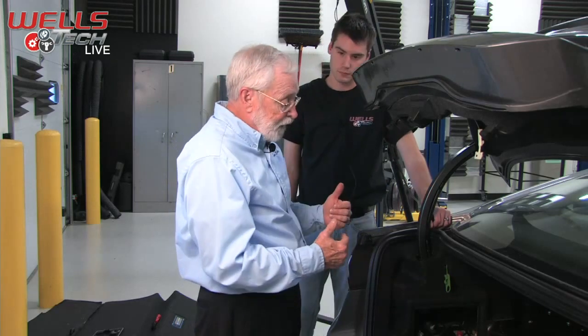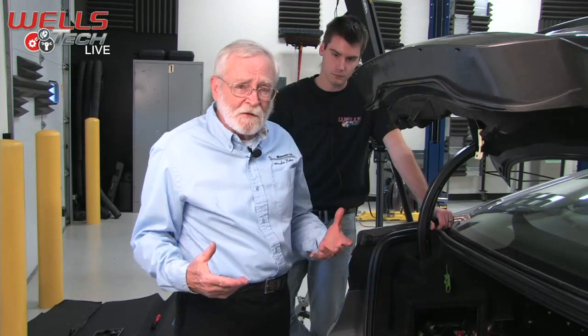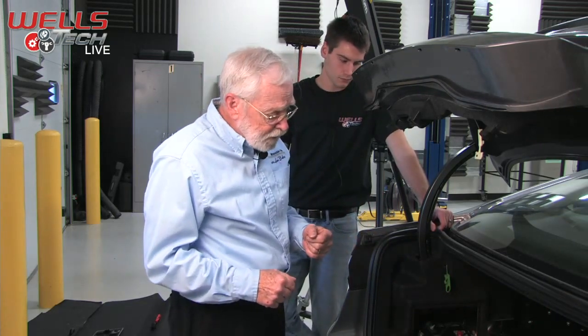However, if we did not get a climb in voltage, that means the DC to DC converter is not working for some reason, or the cabling between the DC to DC converter and the 12-volt battery could have issues. So what we need to do is check the output of the DC to DC converter.